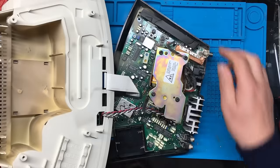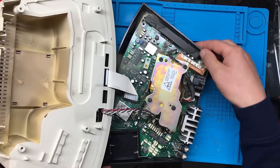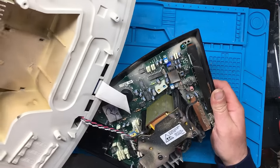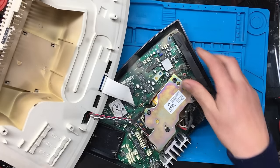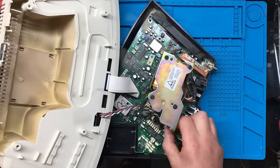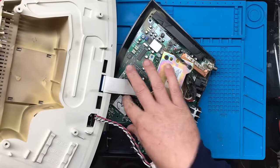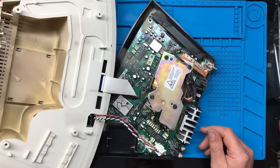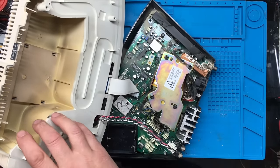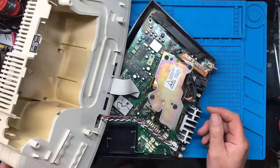Right, that's a bit better. Let's see what we're doing now. I can see a fuse down there. That looks mainly like the radio part of things. I guess this is the amplifier here, and those will probably go up to the speakers. I think we'll just unplug those for a moment to give it a bit more wiggle room. And I guess this is the ribbon cable that goes to the actual clock at the front. I'm not too sure how this bit separates from the rest of it - I can't see any screws, unless it's just clipped together.